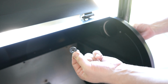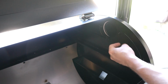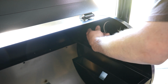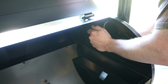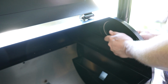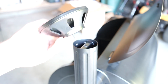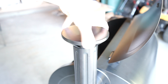And yes, the manual once again labels those metal washers as gaskets. Anyway, using 1 wrench on the inside nut and 1 wrench on the outside bolt, tighten each one down until quite snug. Note that as you tighten, the foam gasket will compress. Make sure they're tightened pretty snug, but you probably don't need to go out of your way to utterly and completely flatten that gasket to death. To attach the chimney cap, simply screw it onto the top of the smokestack using the integrated bolt.